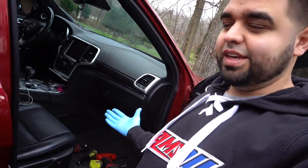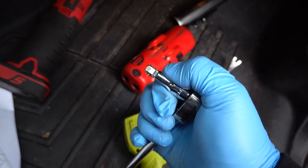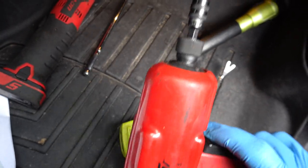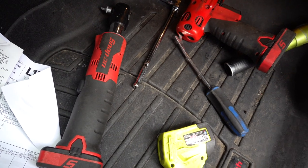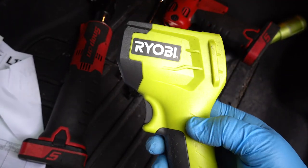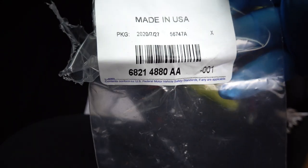And just like that, we're all back together and everything is working — we can stay warm now. Just to recap the tools: flashlight is optional, you can use your phone; long quarter-inch ratchet with a 1.5-inch extension; 7mm for the bolts on the bottom of the plastic; the trim tool for the clips; and T20 torx bits. I'll post links to all the tools in the description. I used a Ryobi temperature gun but you don't really need that. This is the part number for the gear itself — you can get it at the dealership, or I'll try to find it on Amazon and post a link in the description so you can get everything you need.